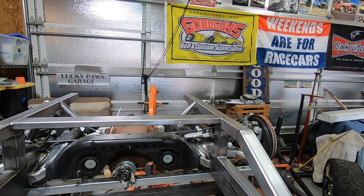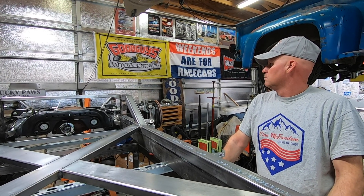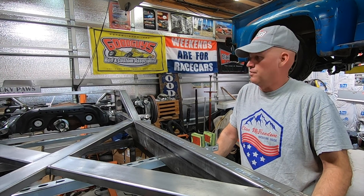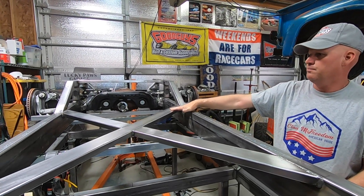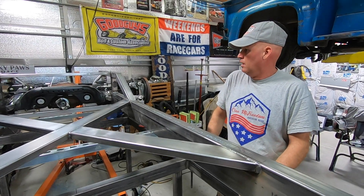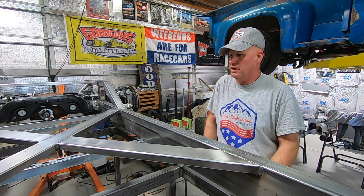That'll hold the gas tank and the bumper. We set it up this high so it'll actually be close enough — it'll tie into being part of the bed mount too. It looks taller just because the frame goes straight back instead of kicking up like it would on a stock frame. We did an X-brace on the front — or I guess the middle part of the frame. And this will be tied in with the muffler hangers and the transmission crossmember. We haven't figured out if we're going to add any other bracing back here, but I think we're good.